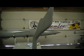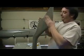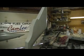This is what I got going. I know you guys are thinking I'm still priming on this — oh no, that bad boy is all primed up. I got it buffed with some of the wires, wet sanded it with 1200 grit paper, and then hit it with that Meguiar's cleaner and that little buffing gun I got at Harbor Freight — you know, that little small one that didn't spin fast enough. I did that thing in no time. I didn't make a video because the compressor was running and it would never shut off the whole time I was doing it.